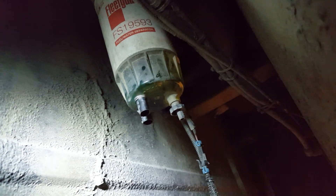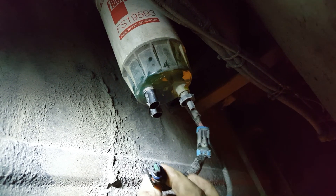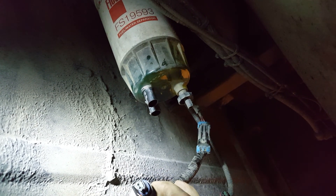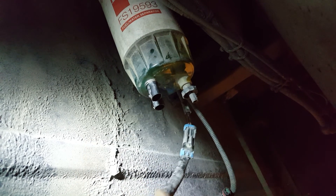So I'm at the primary filter on this two-wire connector — it's the sensor, this one's for the heater. We got to check these two wires; they're shorting to ground or something's going on. There's a blue fuse, and we just got to test the wiring from here back to the ECM plug.